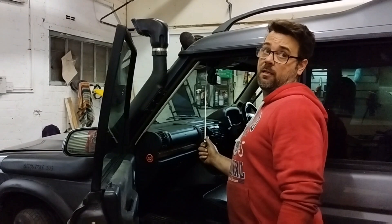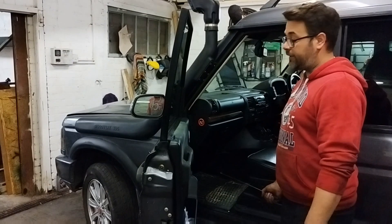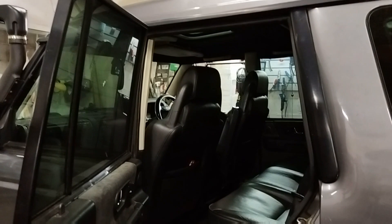Check your headliner — they're normally all saggy, which means they've been leaking. If the headliner's saggy, check the carpets and floors down there. Get that mat up and feel the carpet — if it's wet, it's leaking. Also check the inner wheel arch area as it normally goes rusty. Check your back seats fold, and if you've got seven seats, check those fold as well. Check your seatbelts work. All these little things will catch you out, so put a list together and make sure you get through it all.